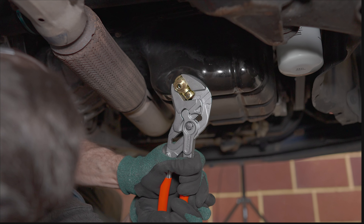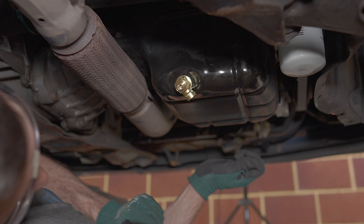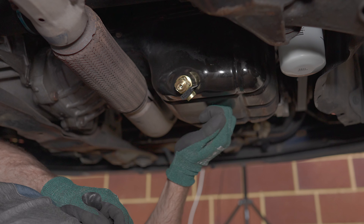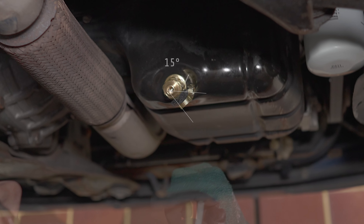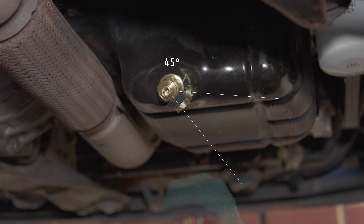All we're trying to do is compress that fiber washer. Make sure your valve is closed, top up the oil, go for a drive, then come back and check for leaks. I've overlaid the original footage from hand tightening and reduced the opacity so you can see both positions. Drawing the angle through there tells me it's 45 degrees, which is one eighth of a turn — though the camera is slightly off-axis so it might be a little more.